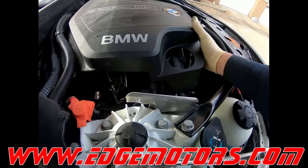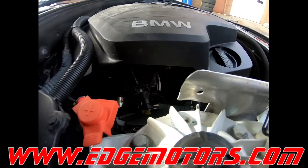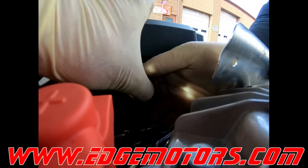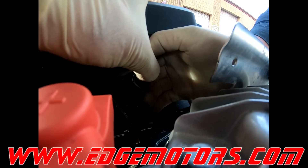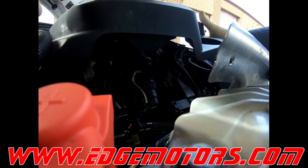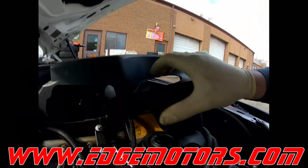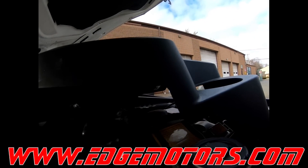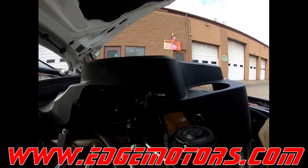To remove the cover, pop it up carefully — don't break the hoses off. To disconnect the hoses, press on the hose like you're trying to close it, press the two buttons on the sides of the connector simultaneously, and slide the hose off. Slide the cover out. You can see somebody's repair attempt — this will never work, so don't try to repair it. If you broke yours, you're going to need a new cover.